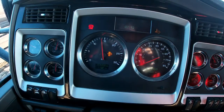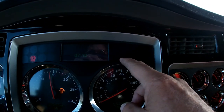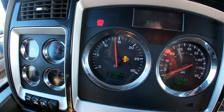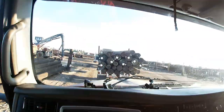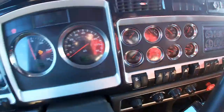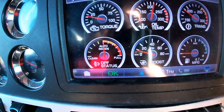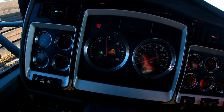We're doing a regen. You can see that symbol — it says the exhaust is hot, and this one says regen needed. I pulled up here at the customer and we have a little bit of time. Let's look at the gauge — they've got some virtual gauges here and this is the DPF status. You can see it is on the edge of dirty, and this started up about 20 minutes ago.